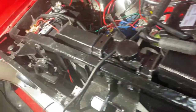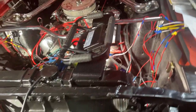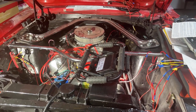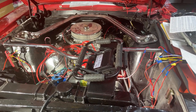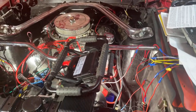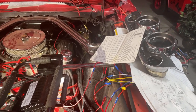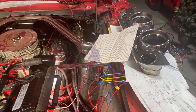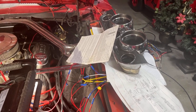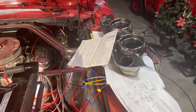There's a lot less wire sticking over the radiator now. The lighting issue turned out to be a misplaced connector — I connected something that shouldn't have been connected, which caused a lot of confusion. When I put my digital dash in, I got rid of the two separate plug-in harnesses for the console and gauge assembly. It turns out those two loose ends on the main harness plug into each other perfectly, and if you're not paying attention you'd think it's an obvious connection — but it's not. Once I disconnected them, everything started working.